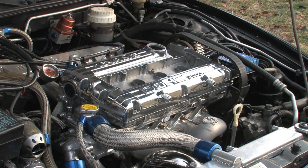Alright, now here's how to avoid cracking your valve cover. I've got all the bolts snugged at this point — none of them are actually tight. You want to start on the inside. The service manual says to only use 3.3 foot pounds, which would be 36 inch pounds — or 39, something like that. But it's not much, it's just hand snugged. You want to start on the inside and snug those bolts down first because that puts the least pressure on the outside edges of the valve cover and is less likely to crack it. Once you crack one of these, you either have to go to the junkyard and settle for something that says Hyundai on it — which is no settlement at all, it's the same valve cover — or just carefully tighten your bolts down and don't break it.